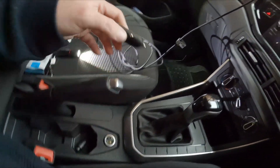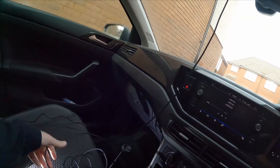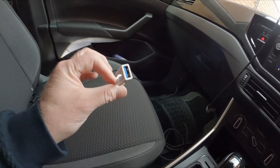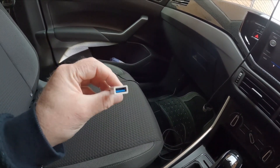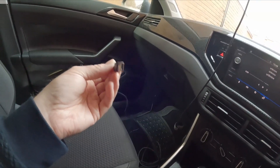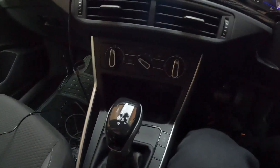For some reason, USB-C to USB-C on a dash cam just doesn't work. What you need to do to make it work is use one of these adapters. They're not expensive — they cost around five, six, or seven pounds depending on the quality. This is a USB-A female connector to USB-C male. You grab the original cable which is USB-A, plug it into the female section, and then that plugs into your USB-C ports on your car.